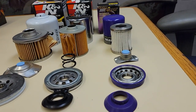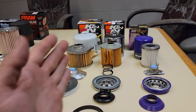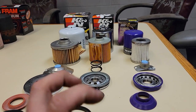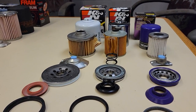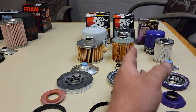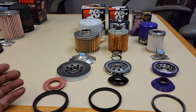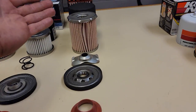I'd say their filtering technology is pretty good, decent. If I had to give it to a filter out of this category, I would have to give it to the standard gold K&N to be honest. Paying the extra money for the platinum for the extra strong can — I don't know that that would be worth it to me. That's just my thoughts. The bypass valve does seem to be a little bit more secure in the bottom with a heavy-duty spring underneath, but I would rather just pay for the gold one if I wanted to throw something semi-performance in there.